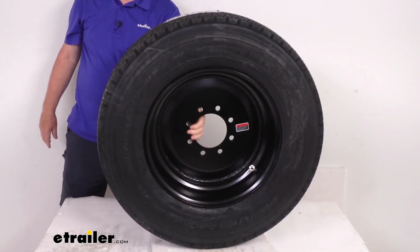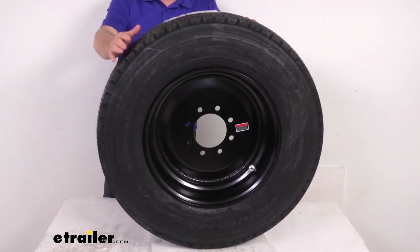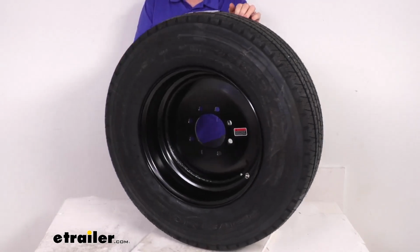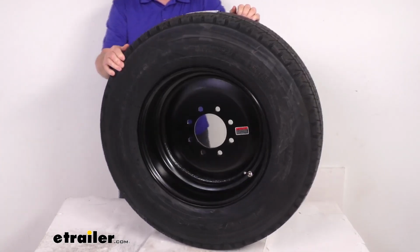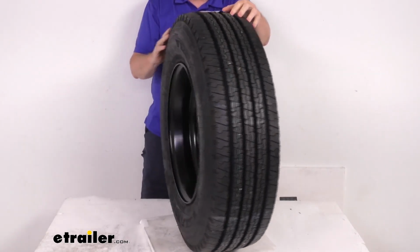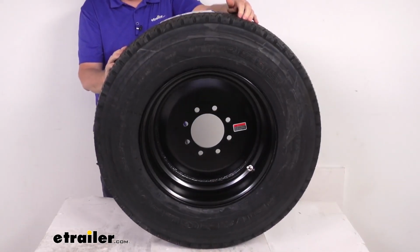The wheel does have a weight capacity of 6,005 pounds, and the tire that's mounted on it is a premium multi-use steer and all-position radial tire. It is constructed with all steel belts to enhance durability and extend the tread life. If you notice, it's got very wide shoulders to promote even wear and better traction, and it offers an enhanced casing package that helps improve toughness and retreadability.